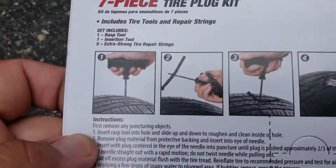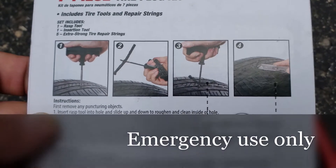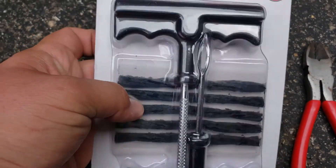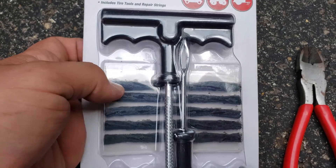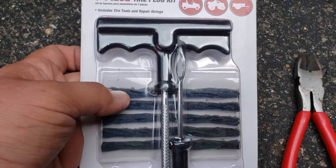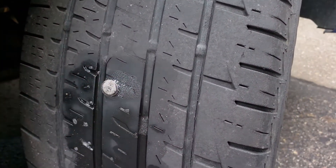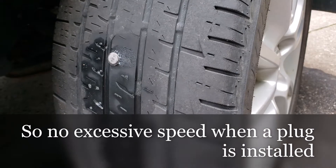This can seal fairly well, but these aren't good for long-term use. Think of it like rope wrapped in rubber or grease that's kind of sealing it off. The problem is that's not 100% sealed, so eventually that'll leach out and you'll just have a piece of rope in there, which allows water and moisture to get in and air to leak back out. This is a temporary fix, and if you have speed-rated tires, this eliminates that speed rating.